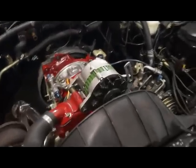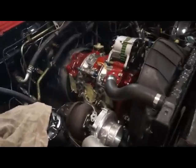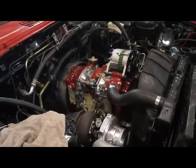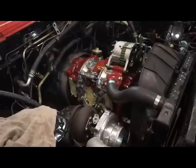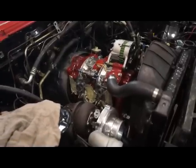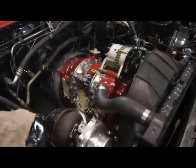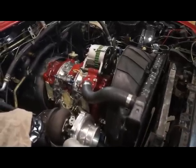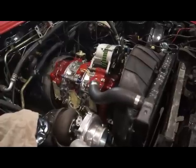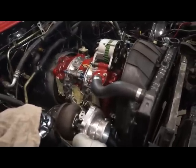It said this motor had, from what, the '93 13B, yeah. Internals? '93 rotating assembly with 3mm seals, very, very mild porting. So it had the rotors from that model too? Yes, the rotors, the crank. We put 3mm seals on the rotors, nothing special, not even balanced. Those are very light rotors, and they're good for close to 9,000 RPM in stock configuration.